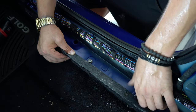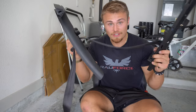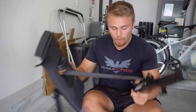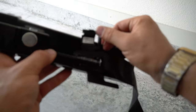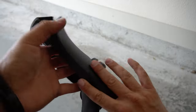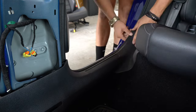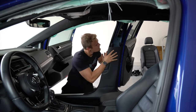Next was putting all the screws back where I got them from. With the seatbelt finally out of the car, I have to figure out how to get the trim back in without the large two-stage seatbelt end fitting through the hole. I figured out how to separate it — you clip it open, slide this piece out, take out the copper clip, and then you can slide it through and install it back on the car. With the seatbelt free from the trim, I can reinstall everything back the way I found it. I'm also mailing the seatbelt and pretensioner out for repair at a place called Safety Restore because I've heard good things about them.